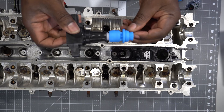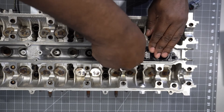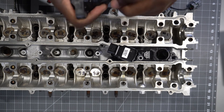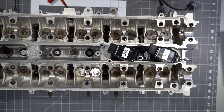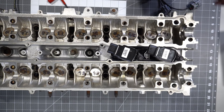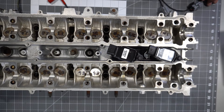That's your assembled stalk and install height. Take the first one, pop it through, and sit it right on your spark plug — twist it down a little bit. Rinse and repeat for the other coil. This is the exact same process for all six coils, though I'm only showing it on two. Drop in the hex flange head bolts and snug those up. Your install is complete — repeat for the other two sets.